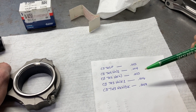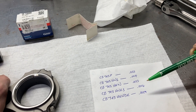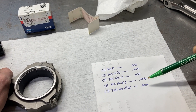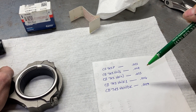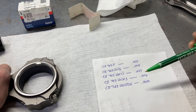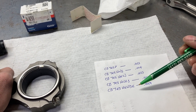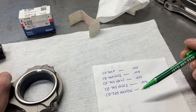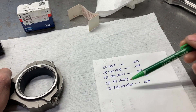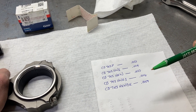A couple other things to note — this is all relative to Clevite. You can also get different results from different bearing manufacturers. It's not uncommon for me to switch from Clevite to Federal Mogul to King just to manipulate clearances a little bit. On some engine families you don't have all these nice bearing choices. For example, on a standard journal Ford FE you really don't have much at all — just a couple of manufacturers. If you want coated bearings you can buy them and send them out to Calico to have them coated. If your engine family doesn't offer many choices, you essentially have to manipulate the crank journal itself — polishing or even grinding the journal down to get the clearance you need.